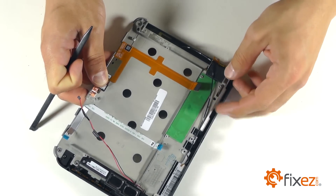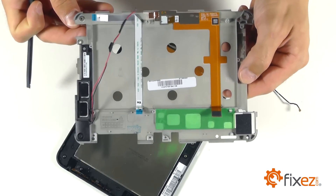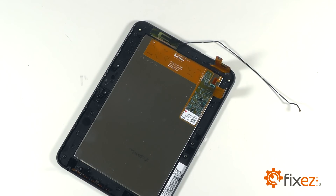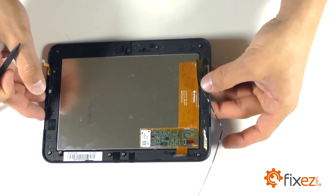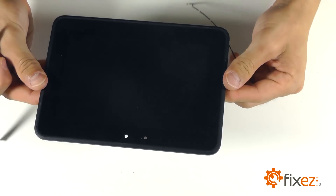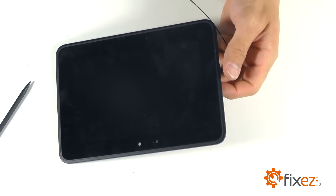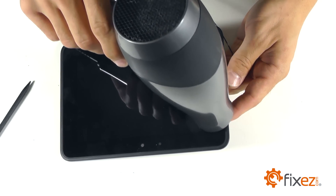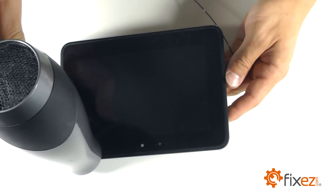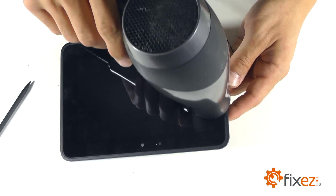If you're watching this video and you've made it this far, it's likely that you have a broken LCD or front touch screen. You'll notice our Kindle does not have a broken glass — it's not recommended to do this procedure as you might cause damage to your display assembly. To begin the separation of your display assembly from the plastic frame, you're going to start with your heat gun or blow dryer and heat up the adhesive that secures the display assembly to that plastic frame.